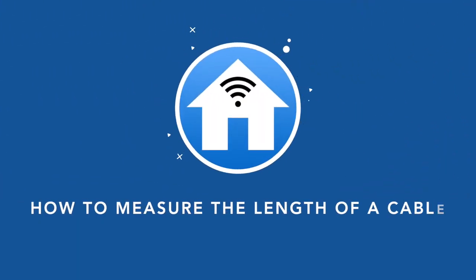Within reason, longer lengths of cable won't reduce your download or upload speeds. If you're using Cat5e cable, which has transmission speeds of one gigabit per second, the speeds you receive are likely to be the same whether you're using a one meter or a 100 meter length. If you're using an older form like Cat5, you will likely see some decrease in speeds the longer the cable is. The take-home message is that you're more likely to get consistent speeds over longer runs when using the more up-to-date Cat5e, Cat6, and Cat7 cables.